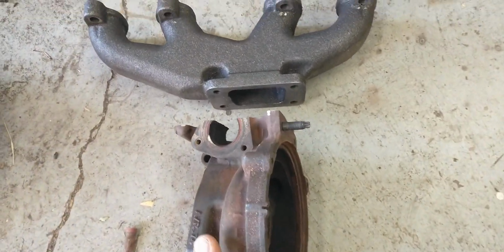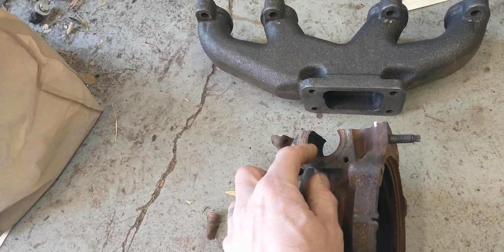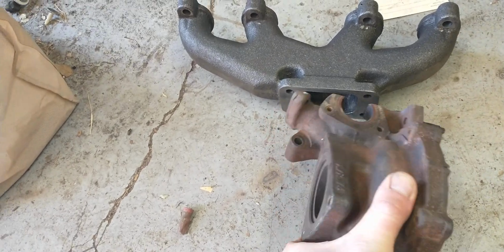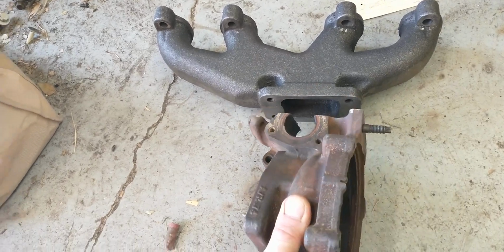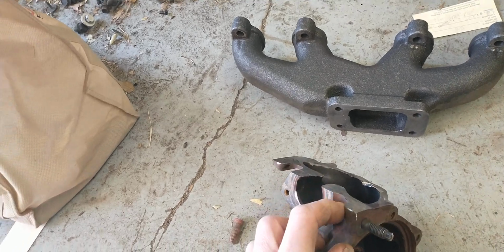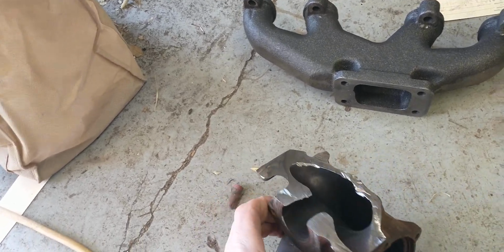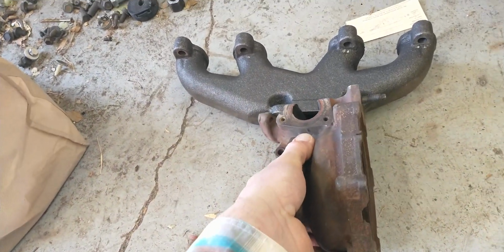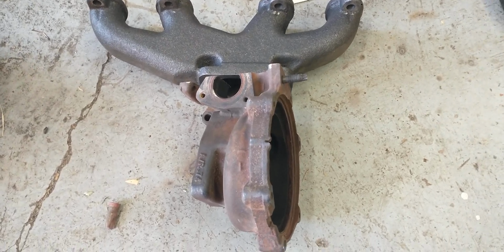And then this turbo over here, again, kind of hard to tell from what it looks like now, but this is a dual inlet, and this would have been the EGR port on. This is a GTB 2056 housing, off of the Eco Diesel, the 3.0 Dodge and Chrysler Eco Diesel. And so with the Y really chopped off there, you really got to cut into everything to get it to come out. But it gives you a nice big opening there. And we got these Chinese manifolds that actually match up really well to run that straight out as kind of a mid mount turbo upgrade setup.